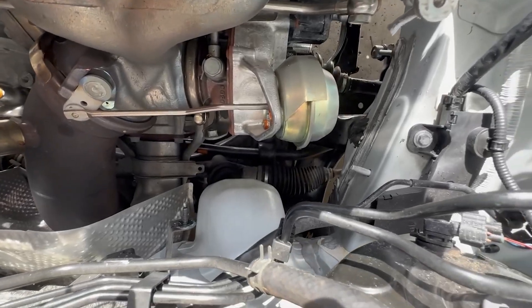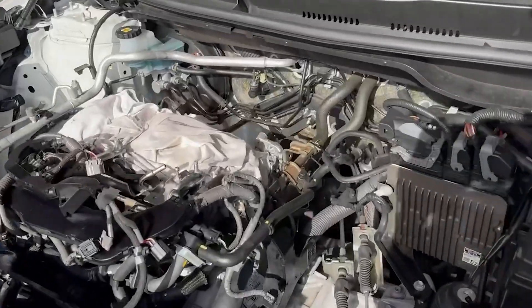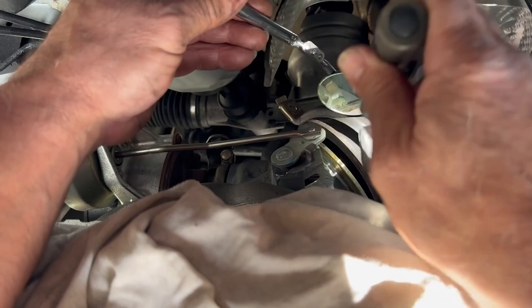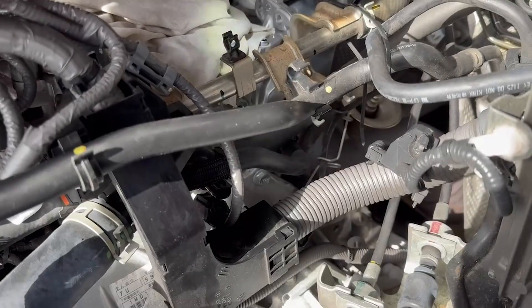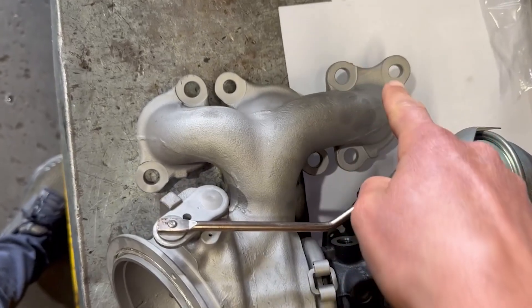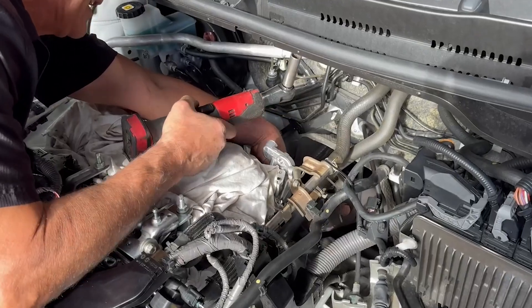I'll do that kind of last. So there's the back of the v-clamp that's been pulled off. Currently the v-clamp goes around here. Oil feed, oil return, and the water ones here - that hose is your water supply. It kind of goes to a bracket there, and then we've got oil and coolant. So we need to take that hose off, which means we're going to lose some coolant. So you're taking off the bolts from the exhaust manifold, 14 mil. That one's done.